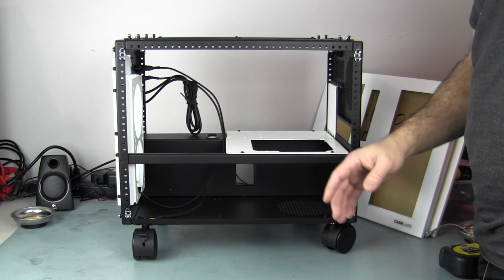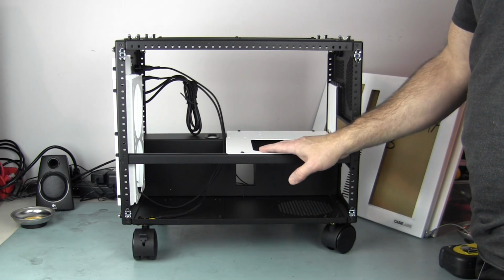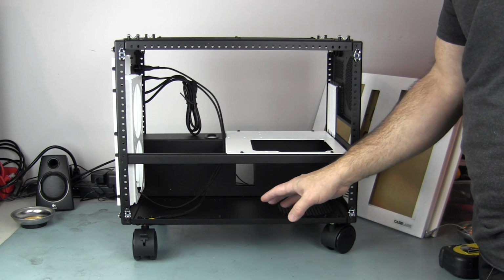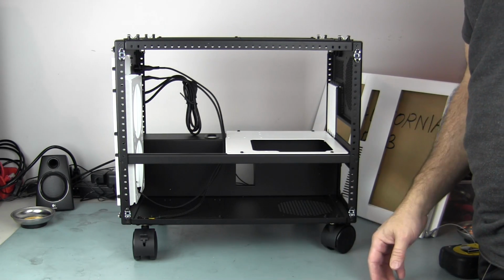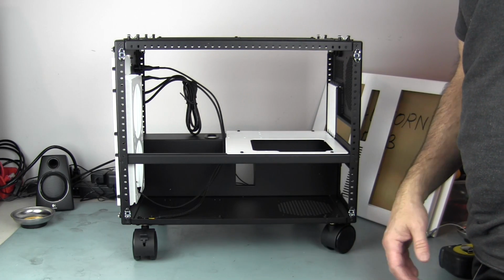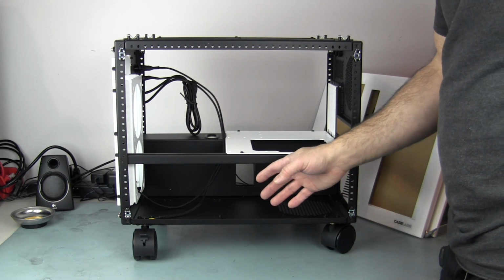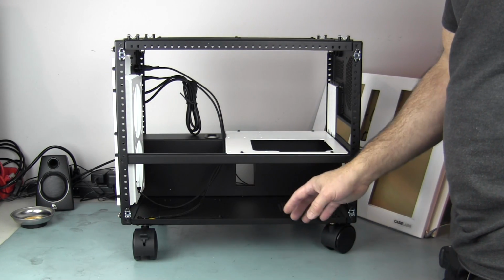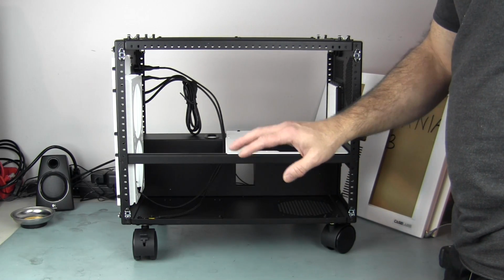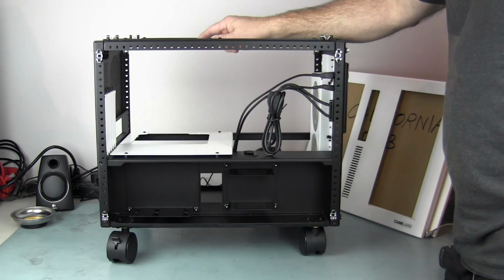And then the one thing that you really need to look at doing when you get a mini ITX, or especially a micro ATX case, is your power supply cables, because typically when you buy them, not many manufacturers these days offer power supplies with short versions of cables. So there are some that do, but not many. And if you don't pick one of those, you then really should be looking at custom making cables for this kind of a rig to keep it clean, especially if you're going to have windows in it and show it off. And that's what this customer's decided to do.